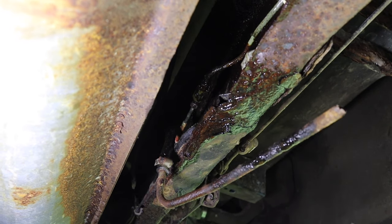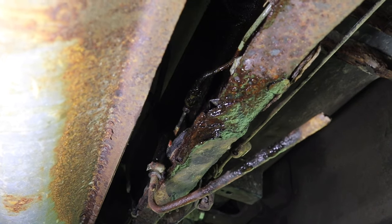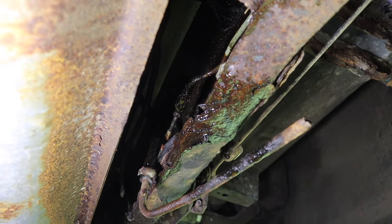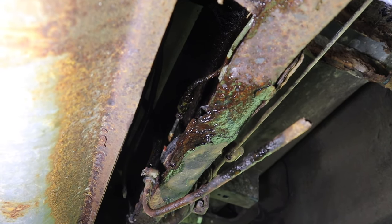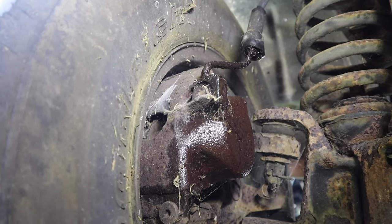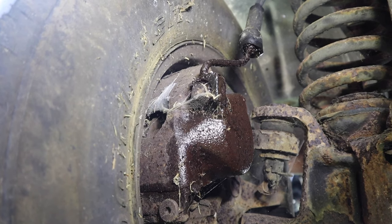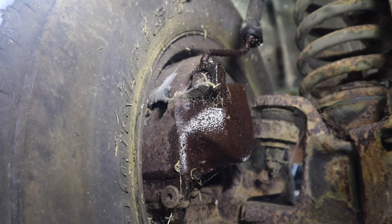It's also bad in the same exact spot. And you know, the frame doesn't look too hot right there either. Not sure what was going on there, but that's definitely a bad point. Either way, that's rear brakes, but I don't have any front brakes either. And the front brake problem is actually the hose and metal. Looks like it probably rust jacked in there and separated, and it's leaking fluid out right there all over the caliper. So that's why there's no front brakes.